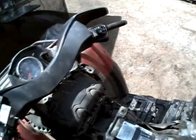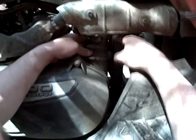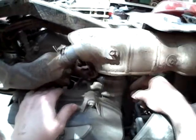I have seen people cut holes in here and put screen work on, and they've had some success, although some people say they're still getting debris inside their breather. Today I want to look at the CVT factory exhaust. I'm hoping it's going to be roughly equivalent to a two-inch piece of pipe — I've got a rubber coupling I'm going to try to put on there. Most people go in behind here close to the exhaust and through that hole, but I'm thinking I'm going to try to come around the back side and eliminate the problems people have been having.